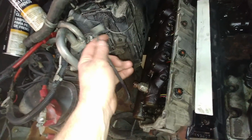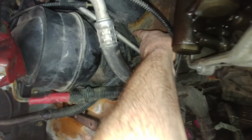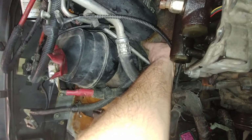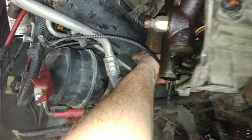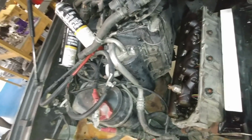Okay, like right here, see this, the four-wheel drive, that's the vacuum line to actuate the auto hubs, the four-wheel drive. You see this little gouge in it right here? See how it's kinked? It was physically ran to right here in between the fender well and the spring pocket and wedged in between there. That's where it was left. And this was sitting just like that. That's where it connects to. So you're not gonna have shift on the fly. I don't know if it would work even if we hook it up, but you're definitely not gonna have it.